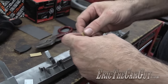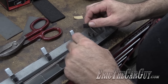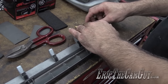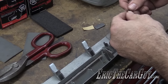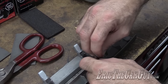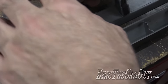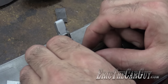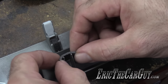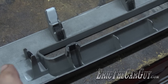I don't know if I like putting anti-rattle on top of anti-rattle. I think I'm going to remove what they have and replace it with what I have, because there does come a point where you just get it too thick — we're talking matters of a millimeter here. I like that so much better. Same thing over here, because I don't really see that factory adhesive staying for too long, especially on a hot day when it could just melt away.